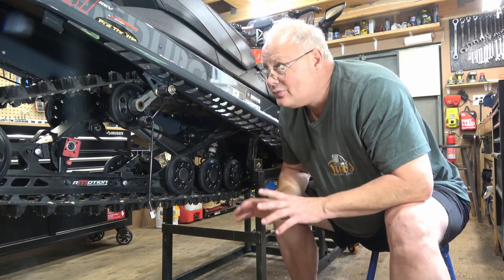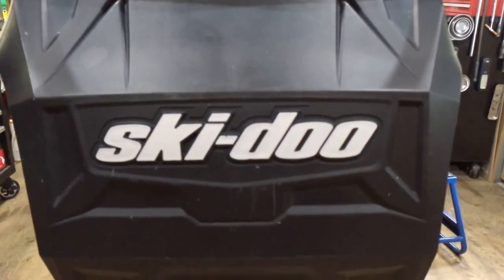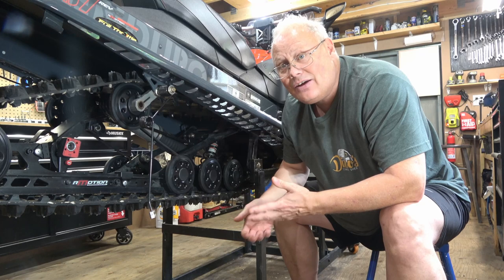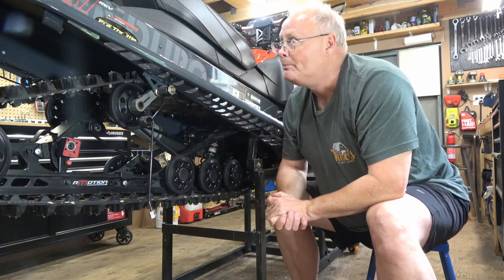and other than that, you just want to make sure your snow flap's also in place because on modern snowmobiles, that snow flap really does sort of modulate the way the snow dust flows up underneath the tunnel. And if it's missing or it's damaged, you may not get the right amount of cooling to these new machines. They can be a little bit fussy.